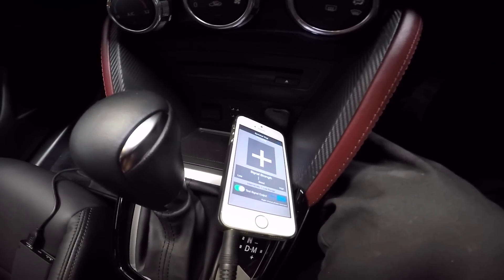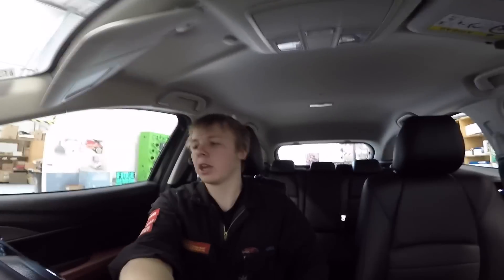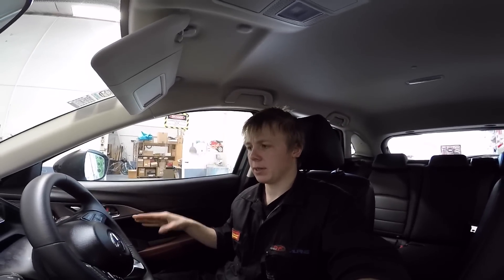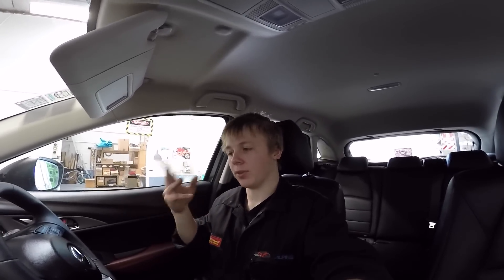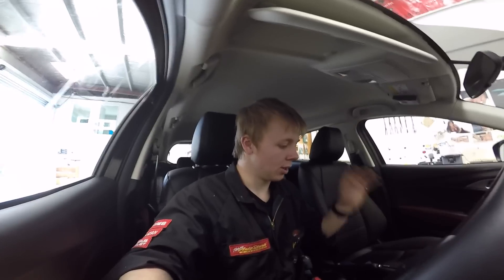Left is positive. Let's try right — the rear right one's coming out negative. Okay guys, I figured it out — I had somehow wired up the front right input wires the wrong way around at the point where I connected it to the factory wiring. I don't understand how I did it, but I've fixed it — simple fix, just reversed the wires on the crossover. Now everything sounds way better, at least on Bluetooth or auxiliary. I also just did a test and Bluetooth and auxiliary are exactly the same quality, so no loss there.